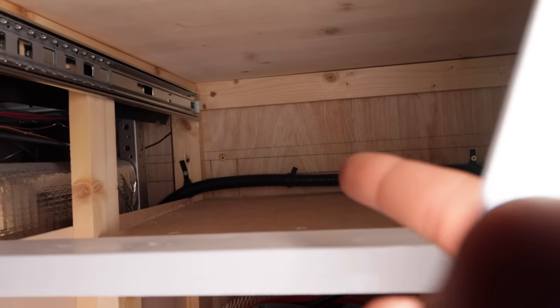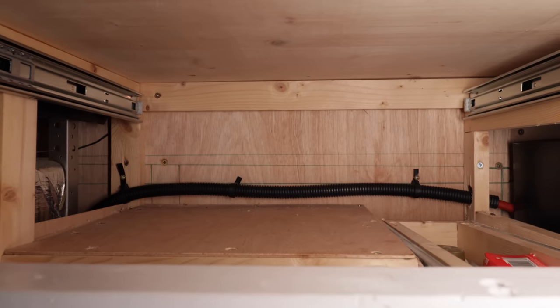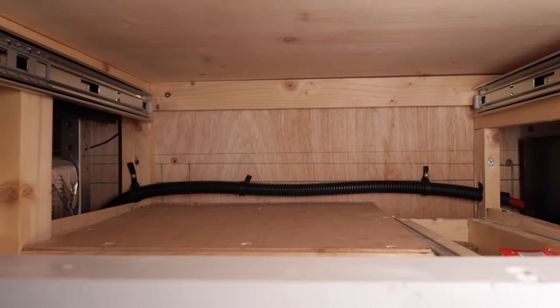What I've been doing is a little bit of behind the scenes work. I did manage to get the extra wire that I needed, because I wasn't anticipating the 5 meter roll of 35mm wire, the one that runs from the starter battery to the other batteries. I wasn't expecting that to actually be 5 meters, and it's literally been the perfect amount. But what I have been doing off camera, I've been strapping the existing wire behind the units, as you can see there. I've been having to use cable ties and then I've screwed them into the wall, but you can see that black lining around it.